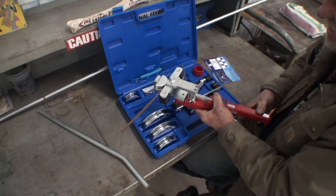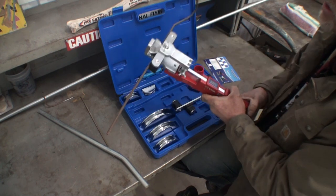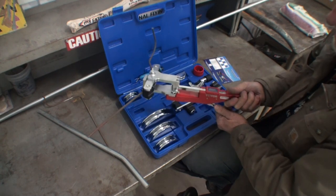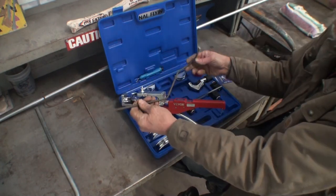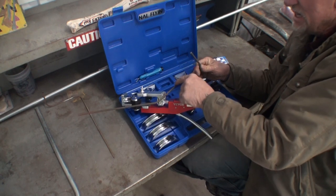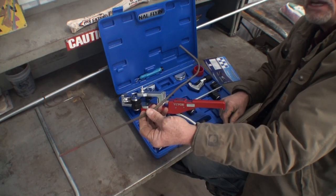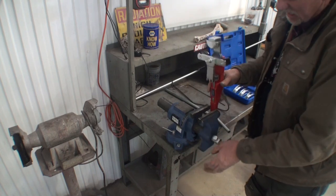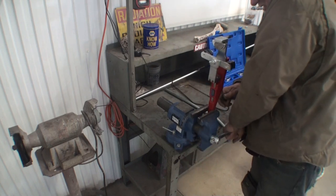You can see how precise that is — if we only need a small bend, just like that, we're pretty much done. Release our handle and then find the next bend we need to make. Let's say this is our roadmap for our fuel line or air conditioning line — we get it where we need it, do our other bend just like that, then release it again. We've created an accurate, positive bend without putting kinks in our lines anywhere. Another way I found out you can use this — if you have a vise, you can put it in the vise and use it that way, giving you more freedom to use both hands.